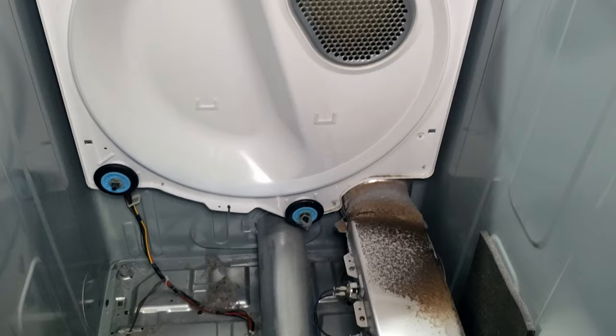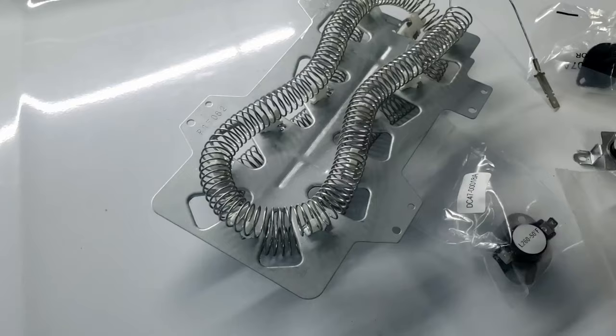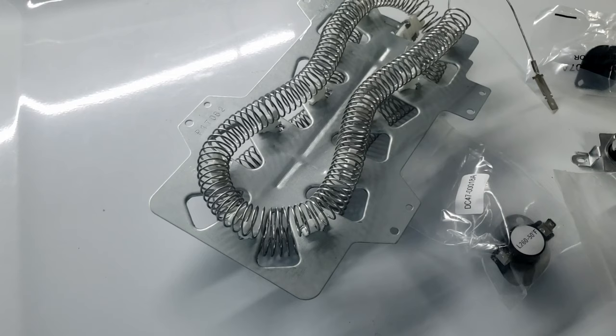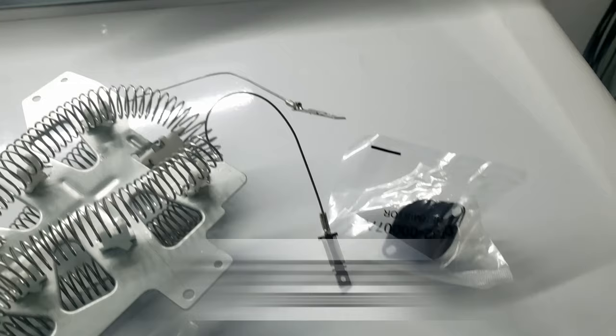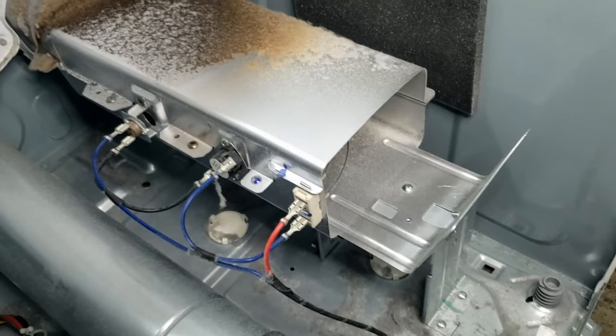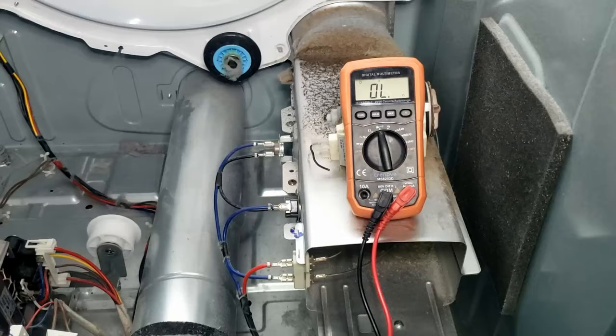Here's the inside of this specific Samsung dryer. When working on the element or heating system, one of the most important things you can do is clean out the lint, as it's a major culprit of a dead heating system. We're going to replace every component in this unit's heating system, so make sure you have all your components handy. The first thing we want to do is inspect the heating element and look for visible damage, and then get a picture of how the wiring is done on this unit for reference before the connectors are unplugged.